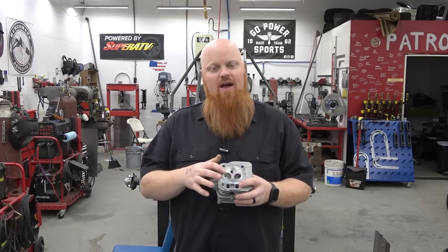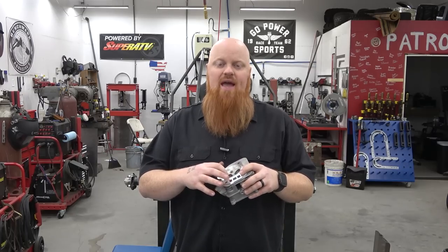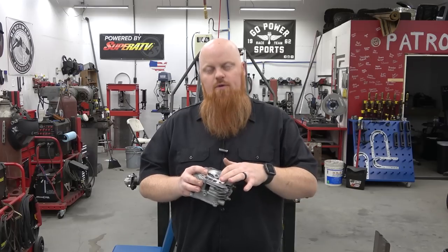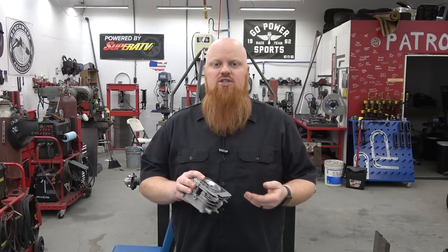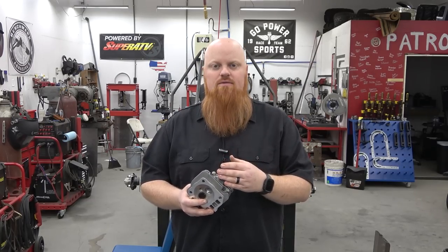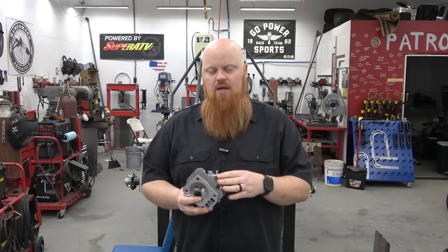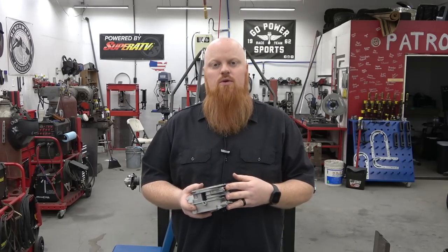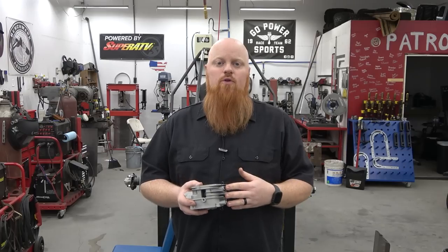And a lot of times the valve seats will have a big lip that hangs over the port. And sometimes that's as big as 10 thousandths of an inch. So if you blend all that in, cut down those edges, look at how the head's flowing and try to improve that flow. And don't really hog out your ports like we were saying. Don't make them massive so you can't even flow that much, but try to port match your intake, port match your exhaust, and that's gonna help this overall build. So half a horsepower more for the ratio rockers.